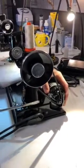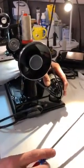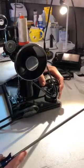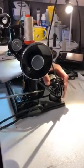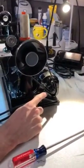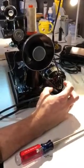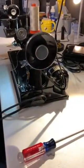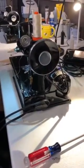I feel like this particular belt is going to give the motor a break while it's still wearing in. If you've ever seen some of the original belts on the Featherweights or just the older belts in general, they are actually thinner in nature. These aftermarket belts have always been way thicker than the original belts. And as you can see when this is running, the belt is not actually contacting these two points — which it was with the thicker belt — where the springs spread out wider and add extra drag on the motor and slow it down. We don't even have to sew to show the difference in speed; just turning it over, you can see.